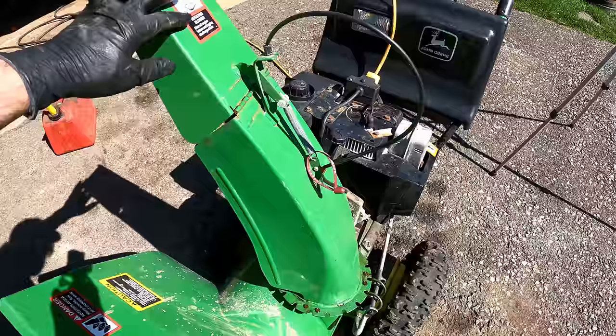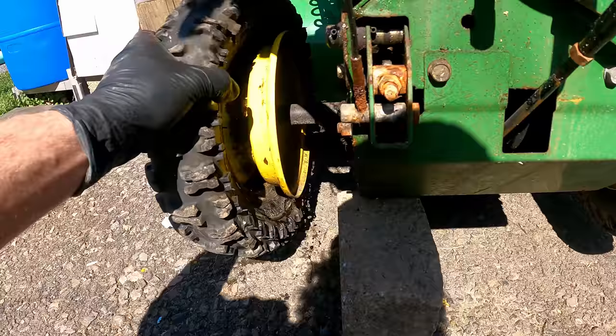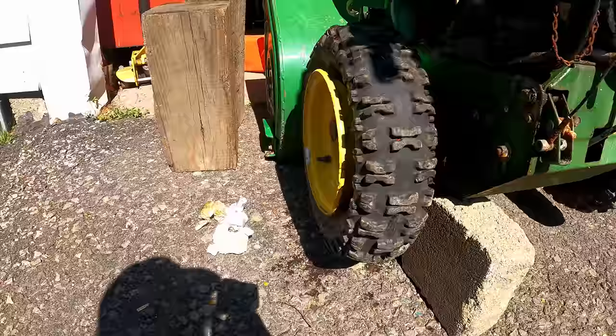This tire pumped up just fine. This one we need the bead seater tank to seal that, or the starter fluid trick, but you see, it's got all that water in it, so I'll pull this off at work tomorrow and just reseal that, clean it out.